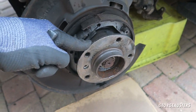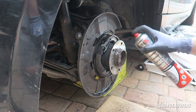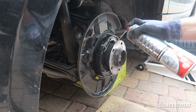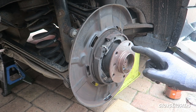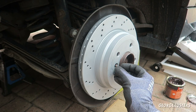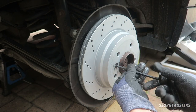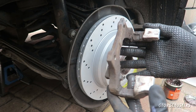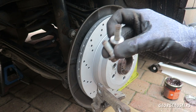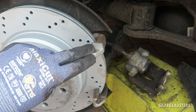I'm not going to be making these as difficult to remove next time. So the next thing I'm going to do is give this whole area a good clean up with some brake cleaner and then obviously grease the hubs. As you can see, I've not been shy with the copper grease - that is fully greased up now. I can go ahead and install the new brake disc, then just secure that in place with the screw, which I've put a little bit of copper grease on as well. The caliper bracket has been given a good clean up with a wire brush and some brake cleaner, and is now ready to be reinstalled with those two 16mm bolts. With the caliper bracket reinstalled and torqued down, it's now time to start installing the pads.